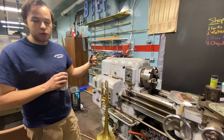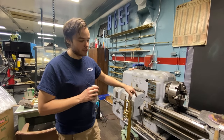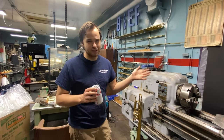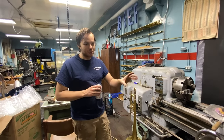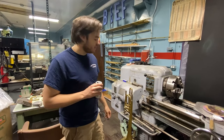When we bought it, it made a really weird loud noise — and it was like that when I bought it, so I got it as a deal because of that. A friend of mine told me the motor bearings just needed replacing, which sounds ridiculous because I've never had to do that. But I looked in there and the pulley on the motor was just loose, flapping around. Set the set screw down and then it runs great.